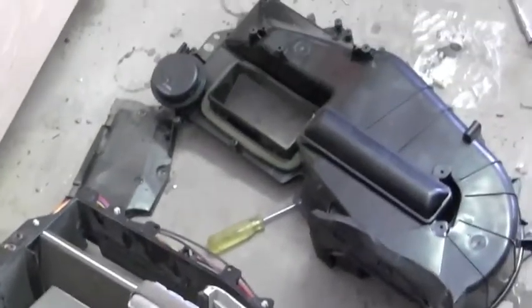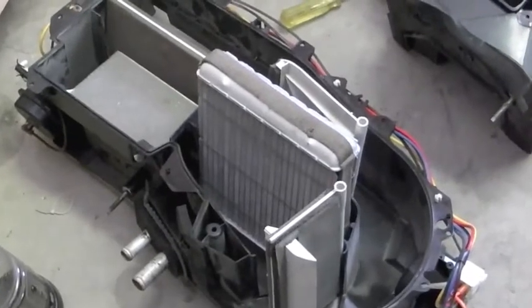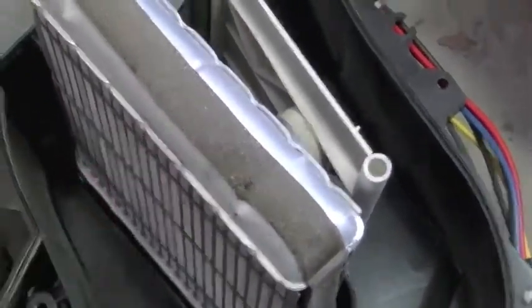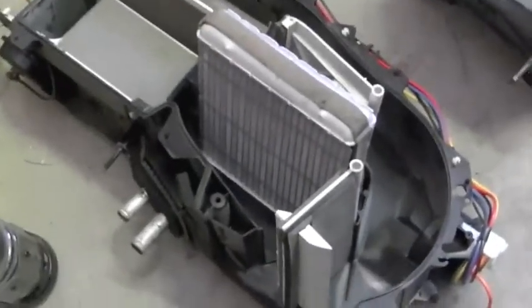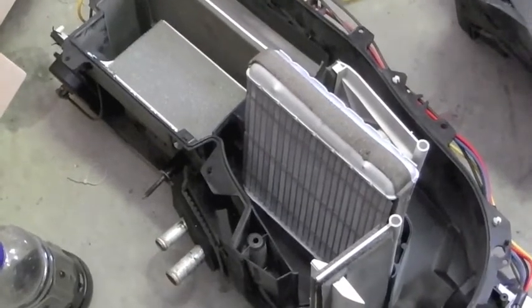Apparently what happens is just the actuator is too strong and this thing bottoms out before the actuator has bottomed out, so it just ends up snapping this thing right off at the neck. With any luck, this will add a little more rigidity to it. We did consider drilling a hole down the end and sticking a piece of coat hanger in there, but there's so little actual material here because Chevy was being cheap. Comparing the new part to the old part, you can see they actually made it slightly more difficult to put the new part in — took a little grinding, but it's in.